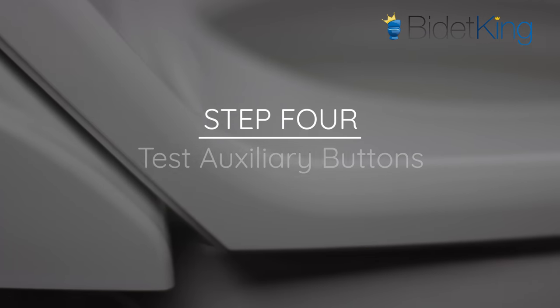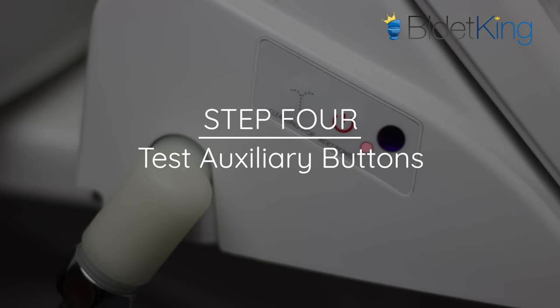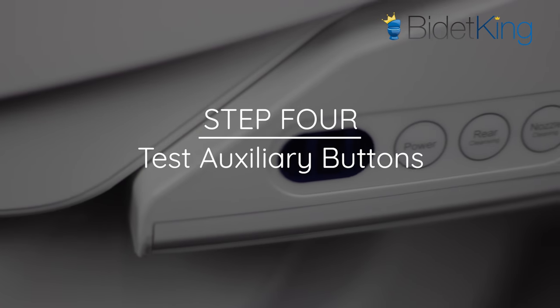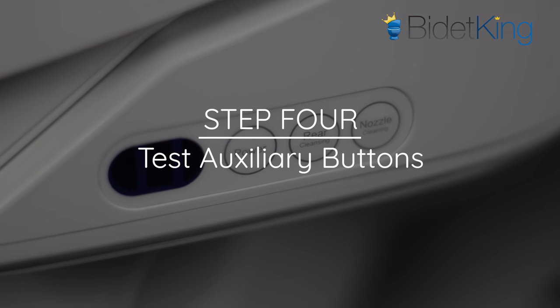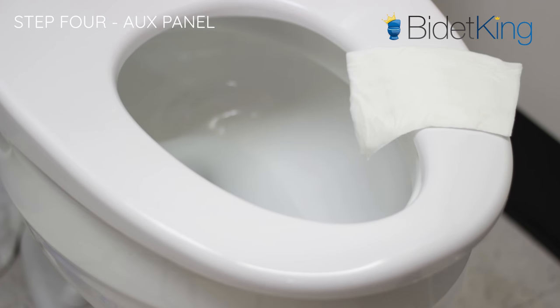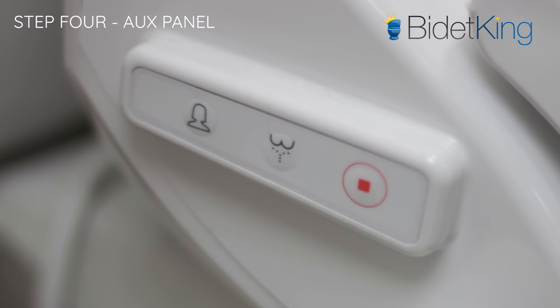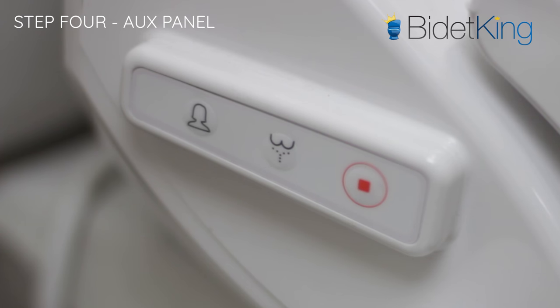Step 4. Test the auxiliary buttons. The next step is to determine whether you are having a remote issue or a seat issue. Most bidet seats that are controlled by a remote control have a small panel of basic wash functions located on the seat itself. It may be located on one of the sides of the seat or at the top. With the occupied seat sensor triggered, try pushing the rear wash button on the auxiliary control panel, not the remote. If the unit sprays, then this may be indicative that the remote control itself is the issue.